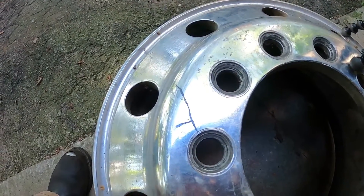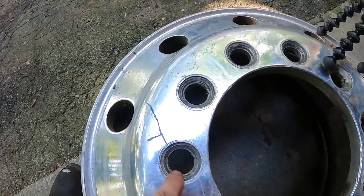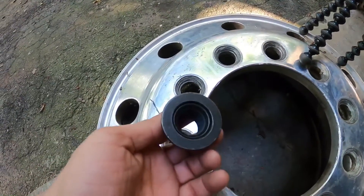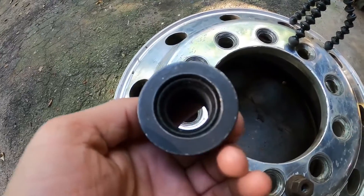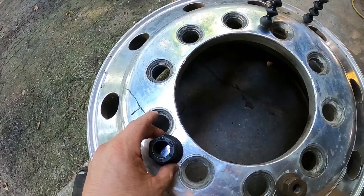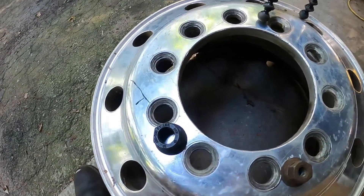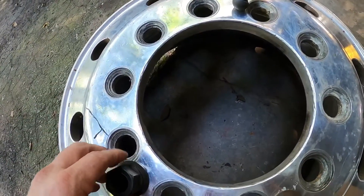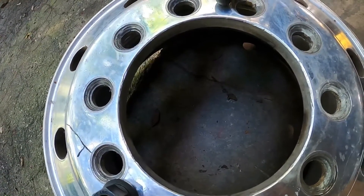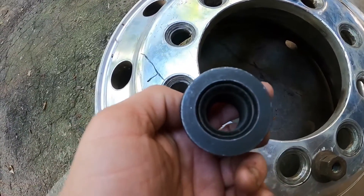Right there you can see the crack, and you can see it's coming from the lug nut hole. This is a rim that has inner and outer lug nuts — this one's beveled. A unilug actually has a washer on it and goes flat against the rim because it's not beveled. It's designed to push on the center hole and keep the unilug rims in place and aligned — the lug nuts just hold them tight so they don't fall off.